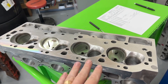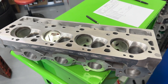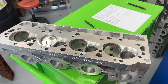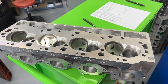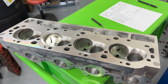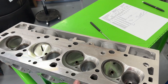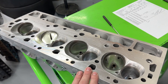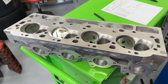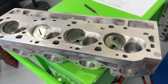This would be one. The Profiler Sniper X comes in three different sizes - I've never done the XL, that's the super huge one. This is actually the first one from Profiler that I've actually flowed as-designed. I flowed one someone else had CNC ported and it didn't do very well. This one was designed by Darren Morgan, who's a famous head porter. It's available from PBM - I sell them as well. Several people have made over a thousand horsepower with this head.